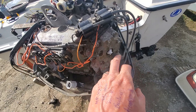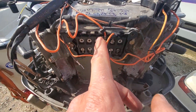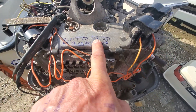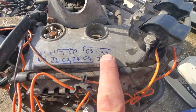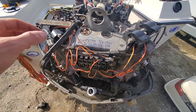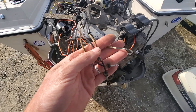The low voltage orange wire from cylinder one's coil would go over here. And then I have coil three, which means the next little wire for coil three is here. And then trigger three. They call it a timer base. What I'm trying to demonstrate here is that the trigger wires need to go to their correct cylinders in order for the motor to run.